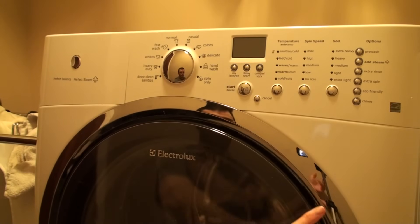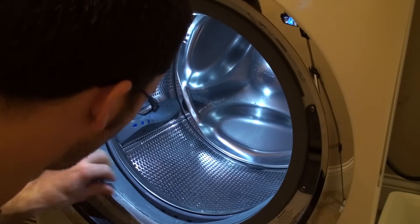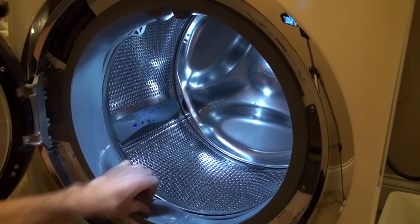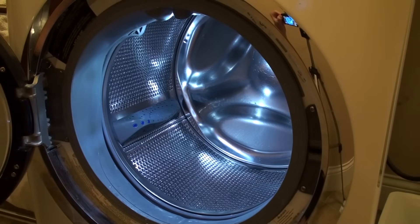Now the cycle has completed. We'll open it up here and take a look. It looks all clean. The gasket looks about the same as it did after I cleaned it with the bleach. If the bleach doesn't get it fully clean, then that other stuff probably won't either, but it does have a fresh smell to it. One of the keys to keeping it smelling fresh is to, when you're using it, just leave the door open so it will actually air out — that helps it a lot. Front loading washers are completely sealed off, whereas a top loader is not sealed off so the air can ventilate. So keeping the door open will help prevent it from getting all nasty and stinky in the first place. Hopefully this has helped you learn how to clean the washing machine. Go ahead and see the link below for the best price I've found on the Tide washing machine cleaning packets. Thanks for watching.